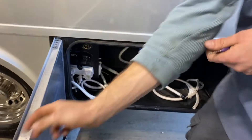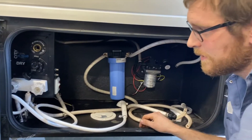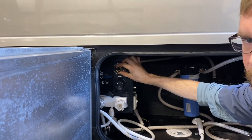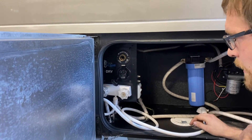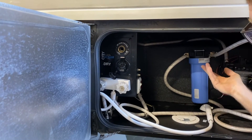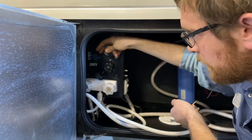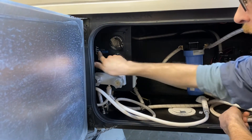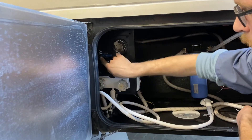This is your water bay — this is where fresh water goes in, and you have your outside shower in here. This very top inlet is not where you fill your fresh tank or get city water; it's actually the black tank flush. Your toilet water obviously needs to be rinsed out to keep it clean and deodorized so the sensors stay accurate. You can also pour chemical down the toilet for the black tank, mix it with water, keep it in there a day or two, then flush it out — that's how you maintain your black tank. Do that at least once or twice a year, and at least once before you put it in storage.